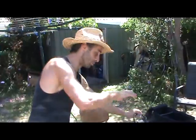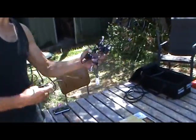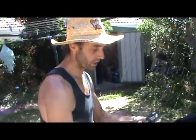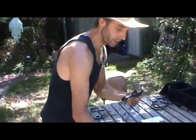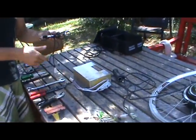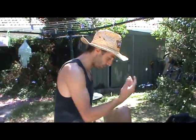There's a strap if you need it, which can help to put books and things under. We also have two parts here — these are brake cables, but you don't really need them. All they are is normal brake cables with a wire that connects to the controller, and when you press the brakes it will kill the motor. They're not necessary — extra cables in the way, extra things that can go wrong.